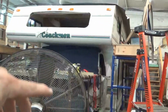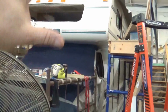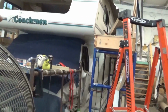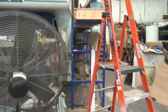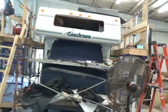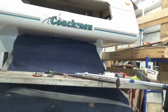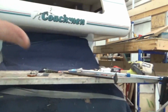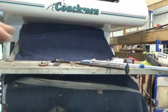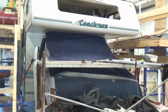Because when I measured everything else, we took it off the mirrors. We took it off of body lines to see if it was true. And the camper and the part that we built, the bunk, is all where it should be. But it's just the camper itself has a lean to the left. That's a little over an inch, about 1.25 inches. So it threw us off a bit to double take and triple take with some measurements to make sure that we're not making it go off. Because sometimes when these come apart, they'll want to sag and settle, and you got to bring them back where they're supposed to be, so you don't end up with issues like that. So, but anyhow, that's what that is. It's the coach, but it's an old one.